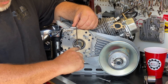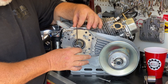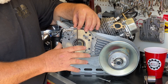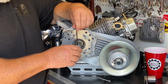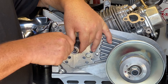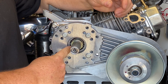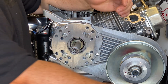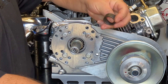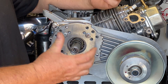Don't be alarmed if your crank is sitting inside — just as long as we have some engagement with this set screw into the keyway on that crank, that's fine. We're just going to snug this down and that's going to keep that unit on that engine. This washer inside here is going to keep the heavy steel bushing from dropping onto the crank itself.